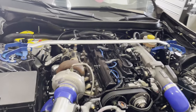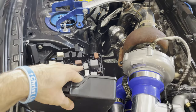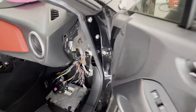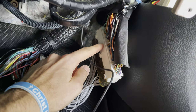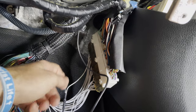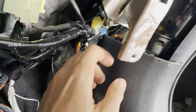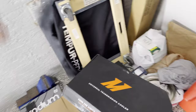This engine bay is starting to look clean. The fuse box is sorted — we no longer need to hijack that relay to get ground on one of those pins. The way I solved it: I traced through the FRS wiring harness and found a wire color-coded black and light blue going to connector A35, pin 26, which provides ground. I traced it through the Performance wiring harness, hijacked that wire, and created a ground connection.